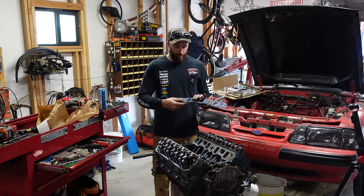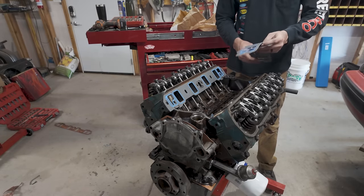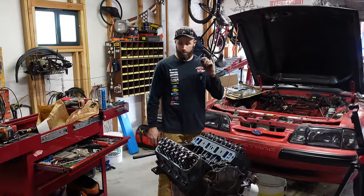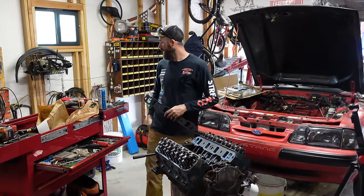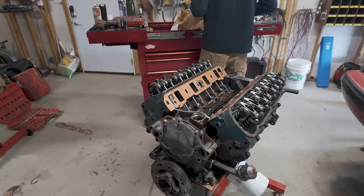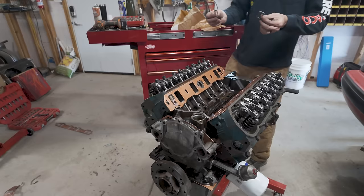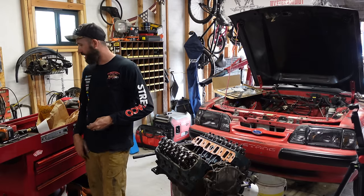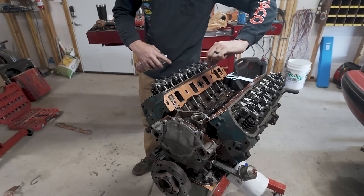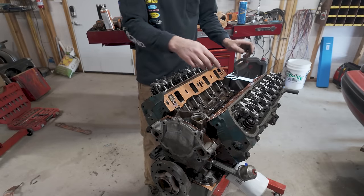So it'll get these gaskets up top, and then it's gonna get a nice little piece in here for the EGR holes, which this intake plenum does not have EGR, so that'll actually just seal that area nicely. But I'm gonna throw some copper gasket stuff on this because you know how much I love it, and I don't like taking parts off ever again. Oh, there it is. All right, those are all coppered up. And then it gets these little guys in the center, if I can find them. Here's one, here's the other. And these are gonna be specific for the EGR because of the hot air that comes out of there. Real hot gases. So we'll just give this a little spray, and then throw it on. Got a little copper on here, don't worry about that stuff. We'll be all right. Right in there, and right in there.